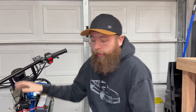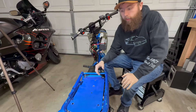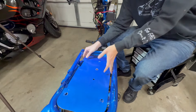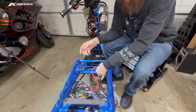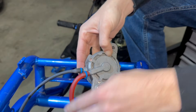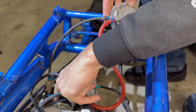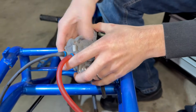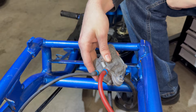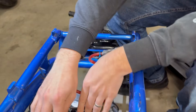Now over at the bike, we're going to take the seat off and get it out of our way. On these Mad Dogs, you'll normally have your vacuum fuel pump mounted on the bottom. I've already taken the liberty of taking that apart, so I can just remove this under-seat tray. This is our vacuum fuel pump — this vacuum port goes into a T that connects to the vacuum port on your carburetor and then to your intake tube, and then fuel goes from the fuel pump into your carburetor. If any one of those lines has even a little leak, it's going to cause you issues, especially this top line.